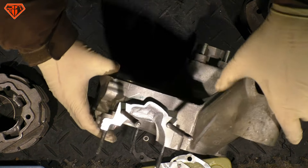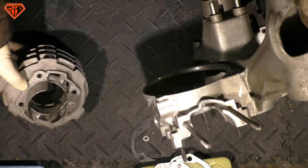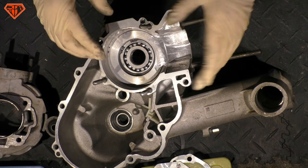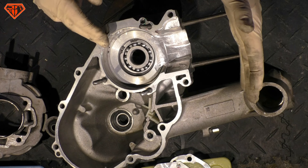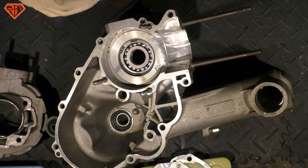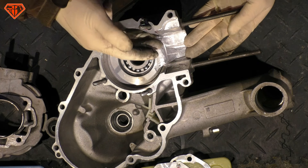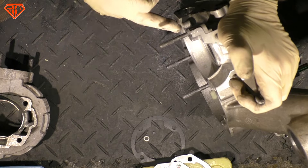What people always forget is that they see these big ports and think: 'That must be a modern racing cylinder — and it's expensive, so it can only be good!' The intake is wider, sure — but what people totally forget is that if you do not extend the intake timings, it still remains just plug-and-play tuning. For proper power you need a race crank and extended intake timings, and there is very little selection of crankshafts for the T5. Just having big ports does not mean good power.